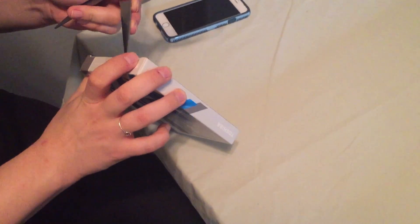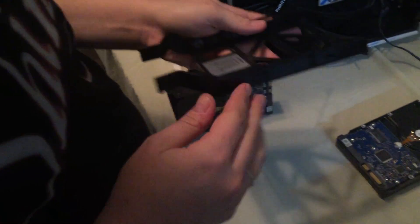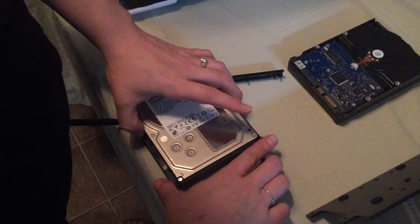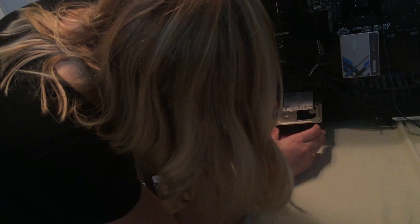This is the solid state drive — 240 GB OCZ — this is where the operating system is going to live. We wanted to show it off but I don't see anywhere in this case where you actually mount an SSD. We'll do the hard drives next. The case has two caddies, which is perfect because we have two hard drives, and these don't use any screws at all — they have little wings that pop open. Pop the drive in, close them, super easy. Power supply is next, then we start wiring everything.